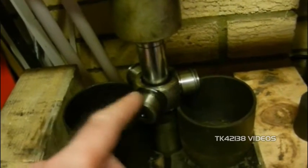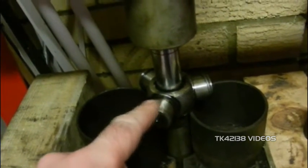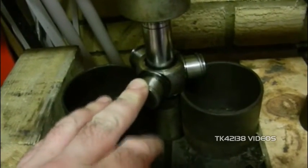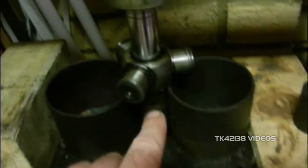So this is what I've had to do: the inner tripod joint, or the spider. The little needle rollers go round here — I've taken these off purely because I don't want to lose them. So I'm pressing this out and it is actually finally shifting. I hope you can see that.